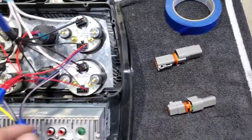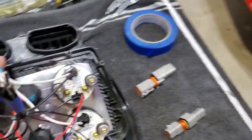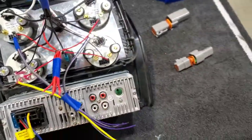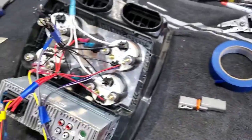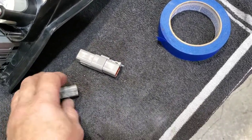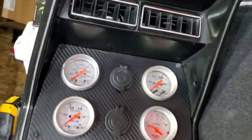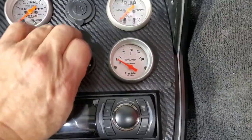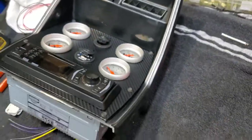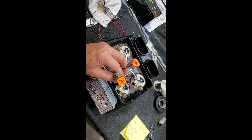Two signal wires for the water temp, one for the fuel gauge sender. We got power for everything to include the round cigarette lighter and dual USB - I'll plug in some radio stuff too. Going to do two connectors: a six-pin Deutsch and a three-pin. Got one of these to charge phones, one for the radar detector. Decided to put it there where it's nice and handy.